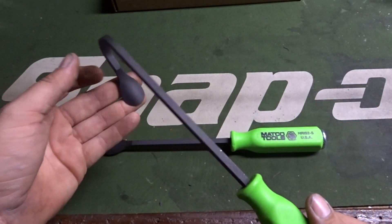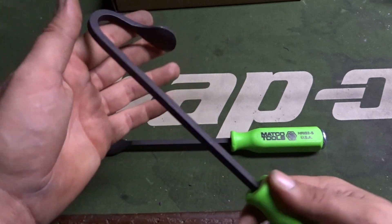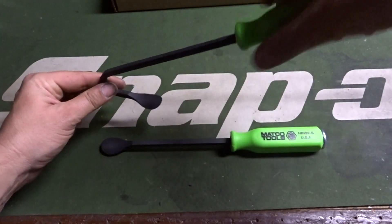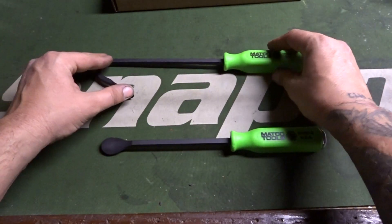This one, I think, is more meant for the water pump area where the radiator hose meets the water pump — scoop it around, pull it down. Thermostatic housing? Go around it, scoop it around, pull it out. That's what I think those two were actually meant for.